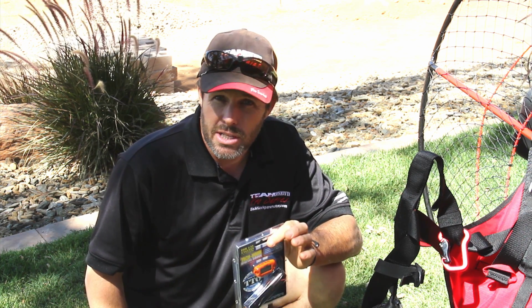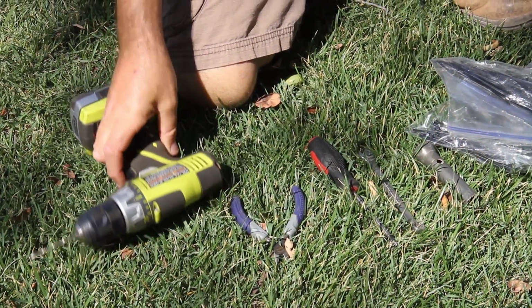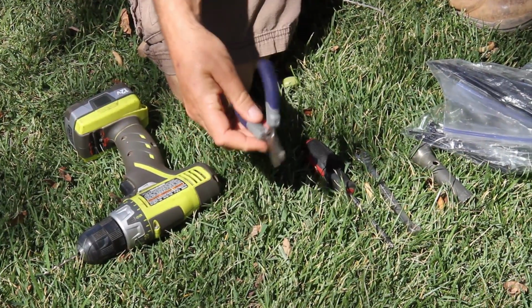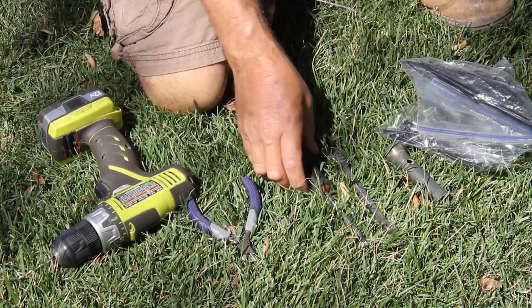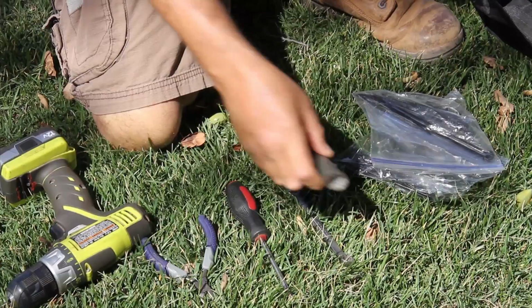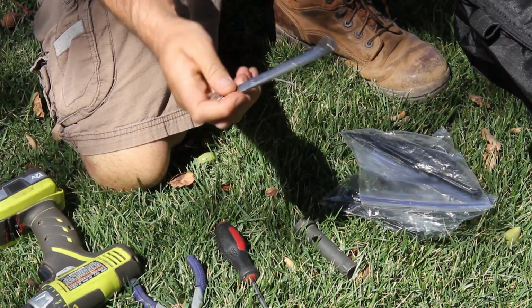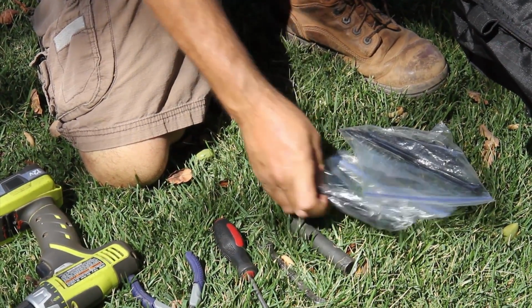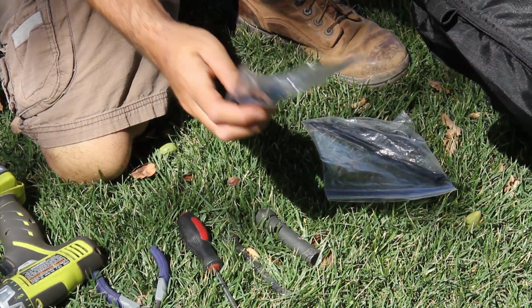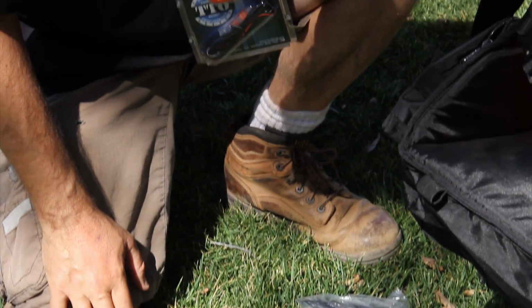Today I'm going to show you how to install them. We're using a Kestrel as the example motor, so to speak. These are the parts and tools that you're going to need to install it. First thing you need is a drill with a 1/4 inch drill bit, a pair of cutters, a Phillips screwdriver, which is really only going to be used to remove your spark plug, and on the HE motors, an 11mm wrench, the very small zip ties, and of course your cylinder head temperature gauge or your tach.